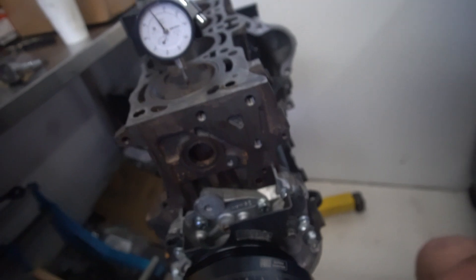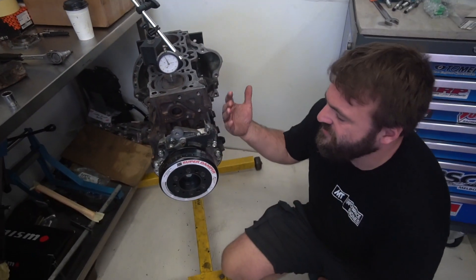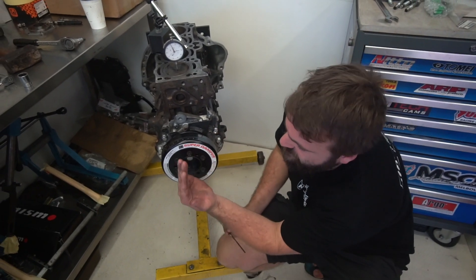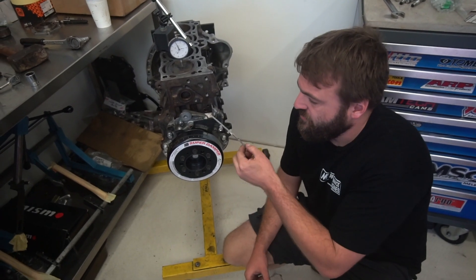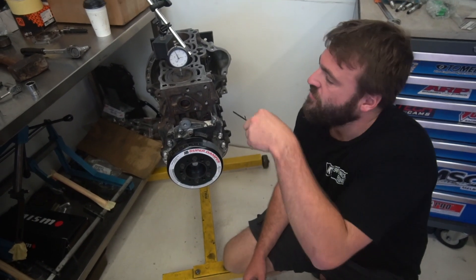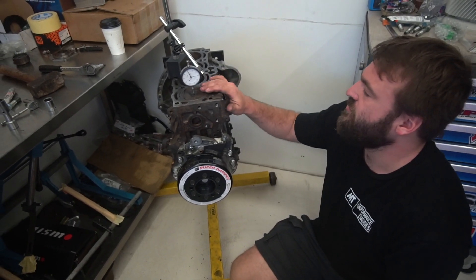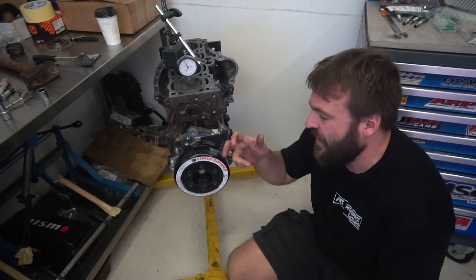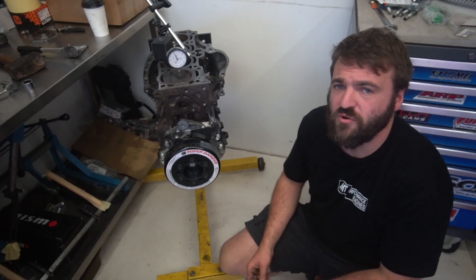So we can now confirm that our crankshaft is in phase with our woodruff keyway, and the woodruff keyway is cut perfectly to the top dead center offset to our plastic cover. So the plastic cover, the damper, and our crankshaft all line up with number one. So if I was now to put number one piston and rod into number four, we should have the same result without having a crank indexing error between one and four.